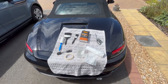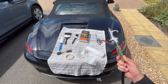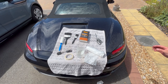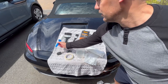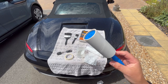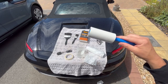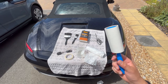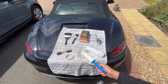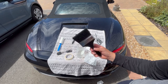What have I got? Firstly, one airline - that's going to blow the roof off and get all the dust out of the nooks and crannies. I'm also going to be using this lint roller, which is what you'd normally use on your dinner jacket to get all the hairs and dust off if you've got a pet. This came from Ikea. We're rolling the roof to get all the very fine contaminants off, making sure we don't seal those in with the FabSeal water protector when we paint it on.